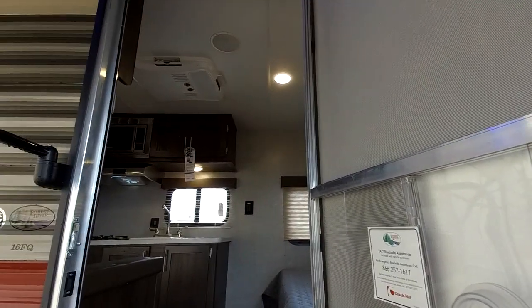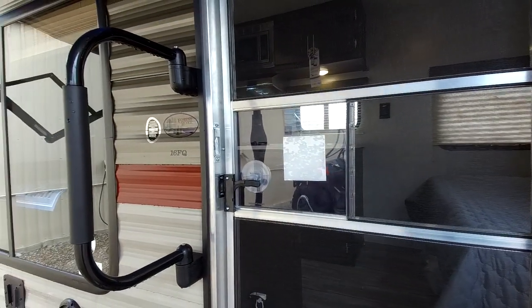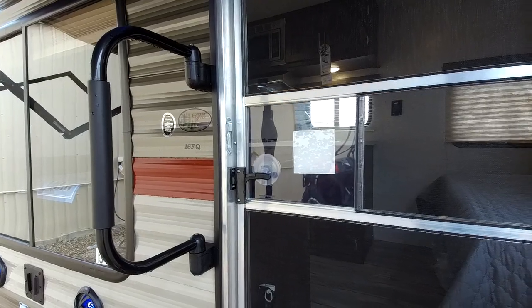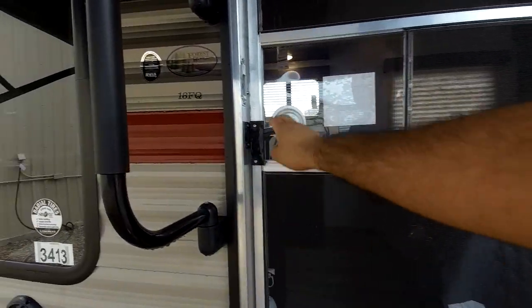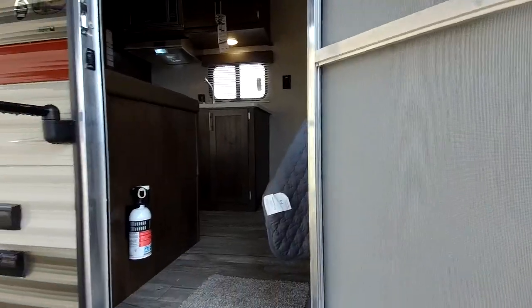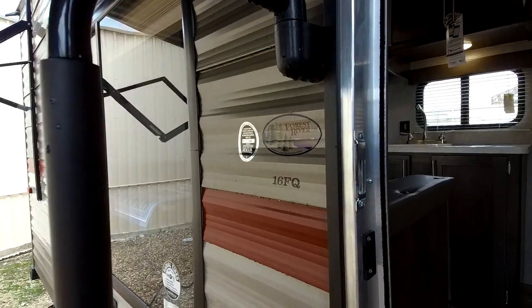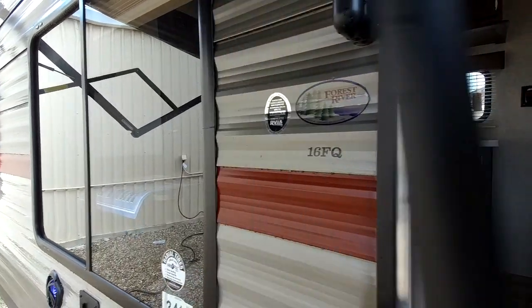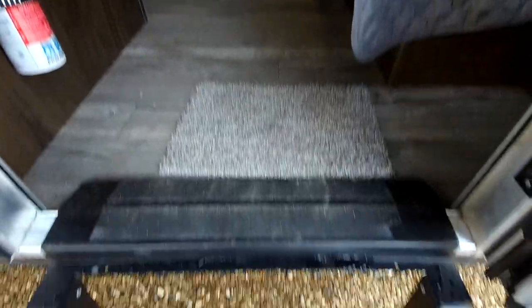This RV has a screen door with a patented door opening system. On a cool breezy day, you can have all the windows open, the vent open in the bathroom, and this going so you have plenty of cross ventilation. This is also a friction hinge door, so you don't have a latch on the door or on the wall — no worries about them becoming brittle and breaking, or accidentally pulling the door and breaking it. This one has the upgraded steps — Step Above steps — with a very low point of entry. The extra large door handle folds three different ways, much better than the small plastic handle some RVs have. The steps have adjustable feet for different ground levels, so they're very stable.